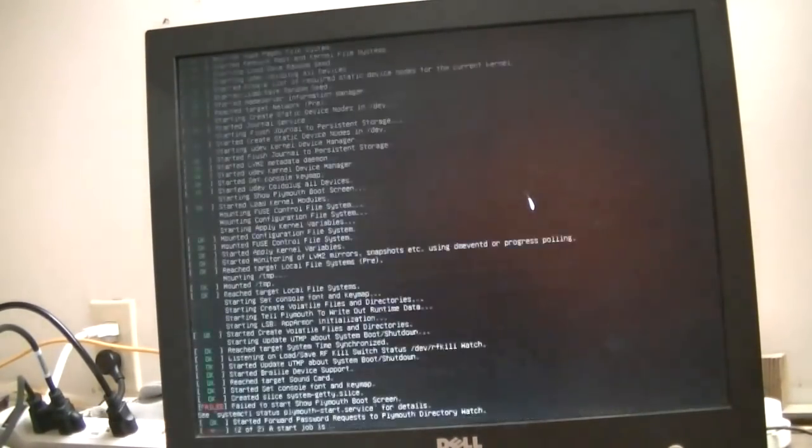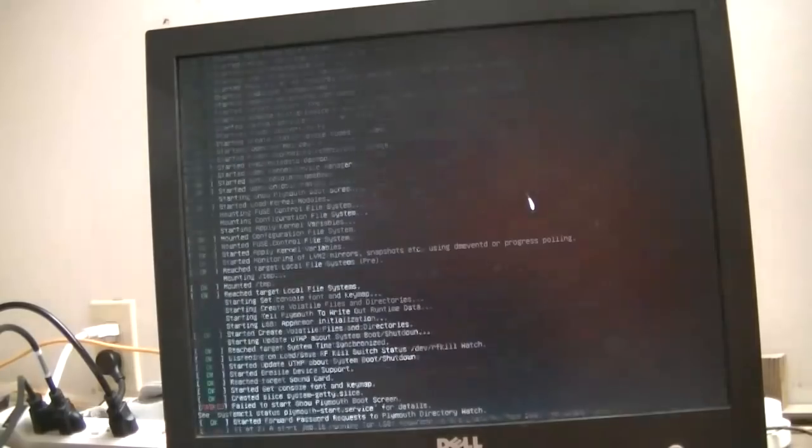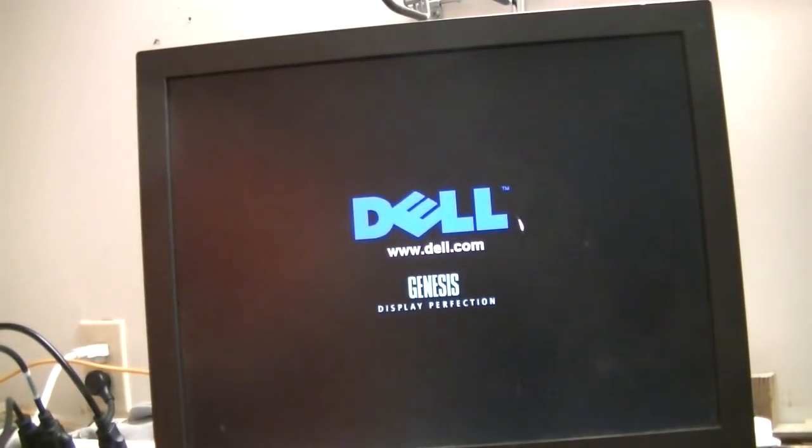Okay, it's been doing this whatchamacallit for the last 15 minutes, and I think it's safe to say this isn't working. So, what I've done is I've created another bootable USB drive using Yumi this time, containing Hiren's Boot CD and GParted itself. And let's see if it behaves better with this than the other flash drive, the Easy2Boot flash drive. Or it could be the memory acting funny again. It wouldn't surprise me knowing this computer.